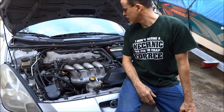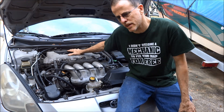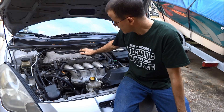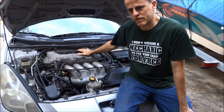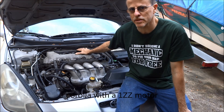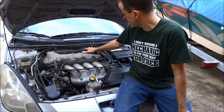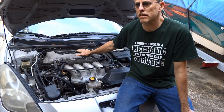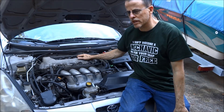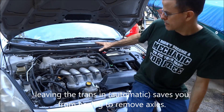Just going to go over how to get the stuff out. On a standard transmission, the engine and transmission have to come out together — it won't clear the clutch, there's not enough room. For an automatic, I've never done an automatic Celica, but on a Corolla you can take the motor out and leave the transmission in. The space looks similar, so you should be able to loosen the bolts from the torque converter and pull the engine out, leaving the transmission behind.